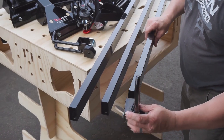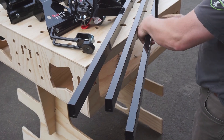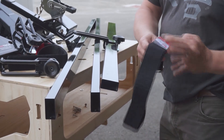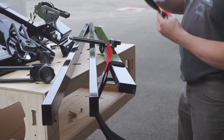I'm going to pre-mount these ladder brackets right on the rail — these can be adjusted at any time, so I'm going to put it approximately in the center. These Velcro straps are to aid you in strapping down the ladder on top of the rack system, so make sure you slide them over the rail before you mount the rail on top of the truck.